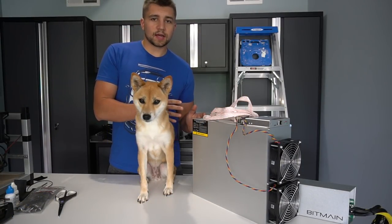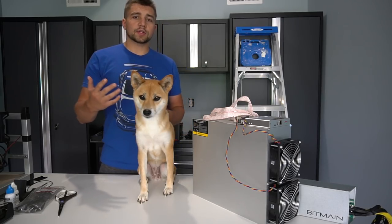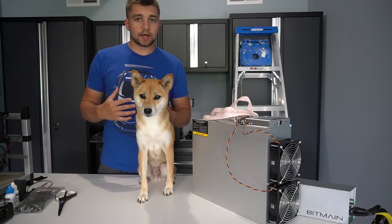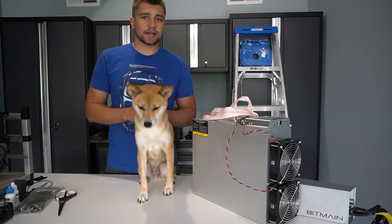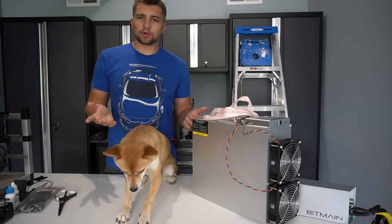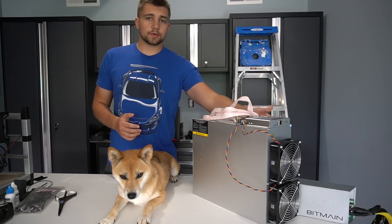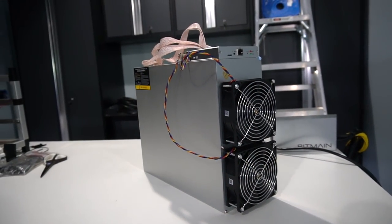If you're wondering about the specifications, originally stated at 180 mega hash a second, now the newer ones that are for sale, selling for about $1,300, are listed at 190 mega hash. This is getting an average hash rate poolside, mining Ethereum as well as Ethereum Classic, of almost 200 mega hash a second, pulling about 760 watts. We're gonna pull it up right here on 120 volt with the Bitmain APW3++, their official power supply recommended for this unit. I'm gonna show you exactly what we're dealing with.